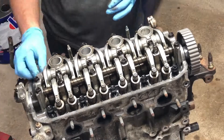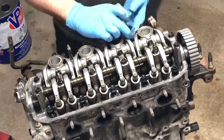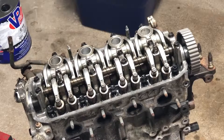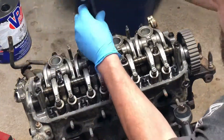I used a D16 Y8 head gasket that I miked out to 26 thousandths of an inch for the thickness, and I torqued the head to 65 foot-pounds. I might try for a little bit more than that once I get a heat cycle or two in — I'll let you guys know on that.